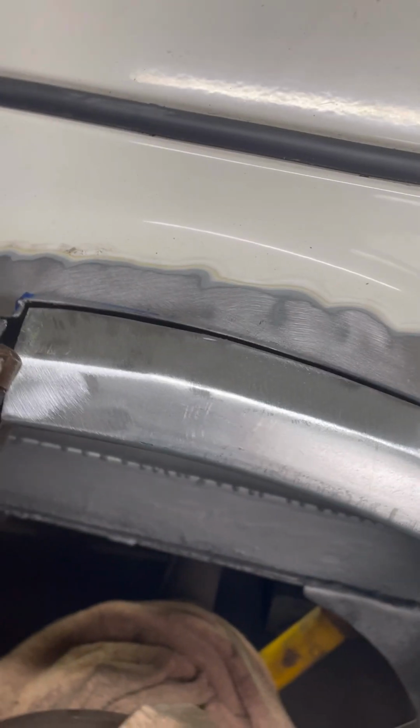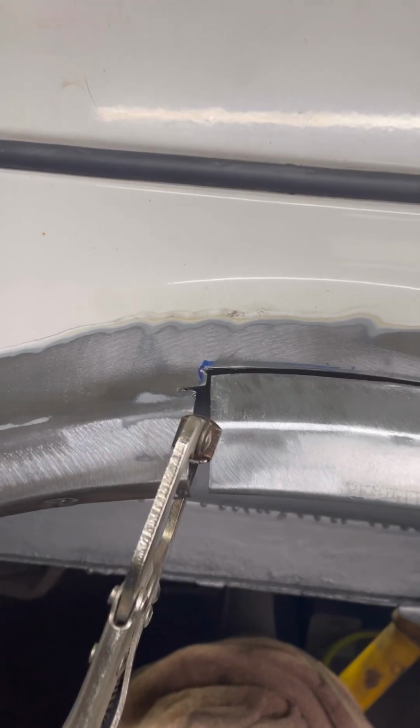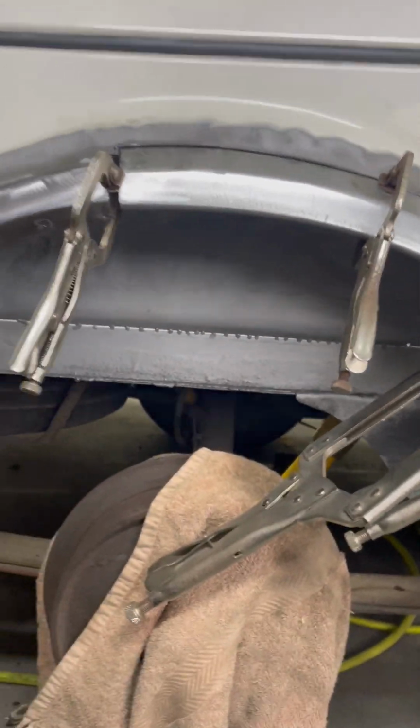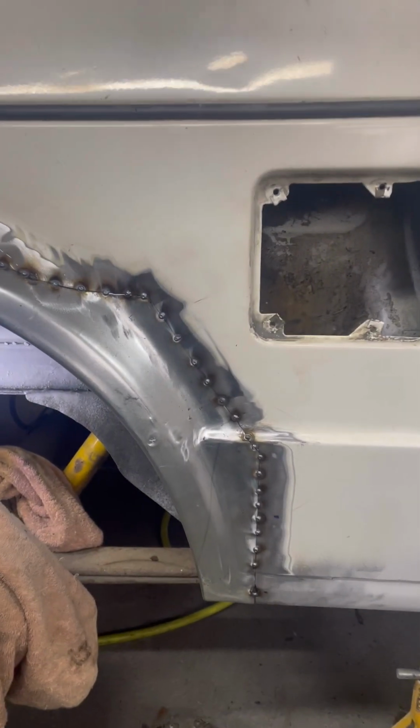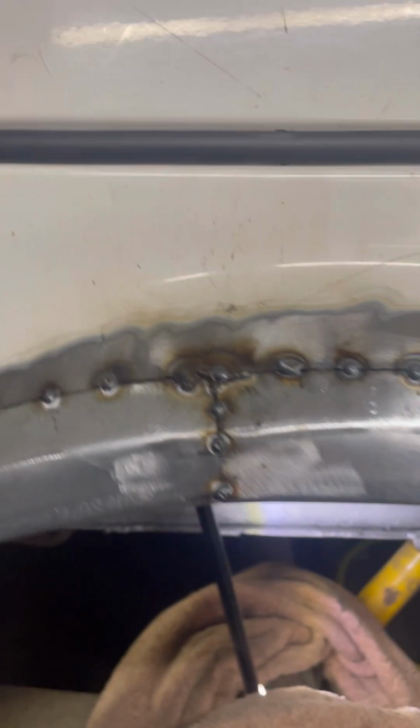It will be good. It's a bit of a weird one because you can't get a Caddy rear wheel arch, so it's actually a Mk1 Golf arch, so you have to modify it to fit. Hence, I'm doing it in 2 sections because the Mk1 Golf arch doesn't fit round all this gubbins. So let's get this one tacked in and have a look. Okay, not going too bad. So I've just nailed that arch in, which is great, because now I can start on the inside. This panel goes on there to cut out that rot. So that'll need a little scribe into there, and that'll take care of that.